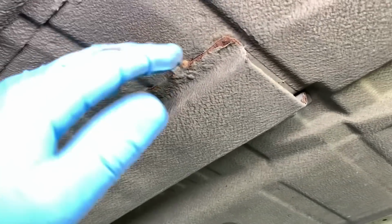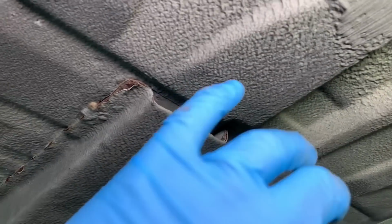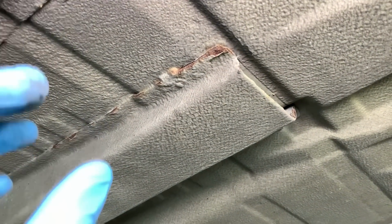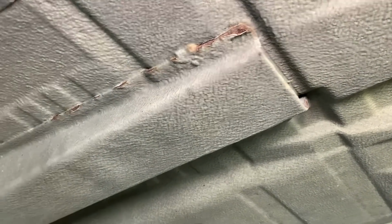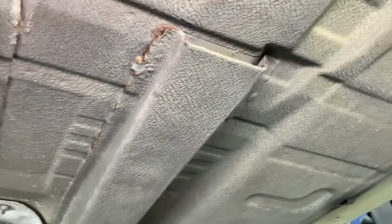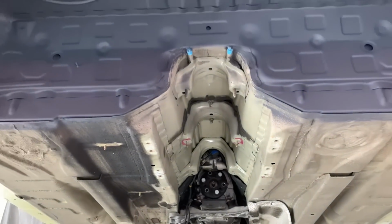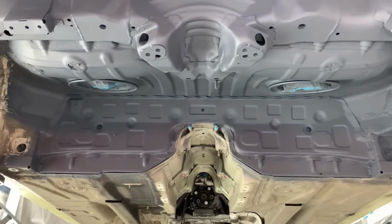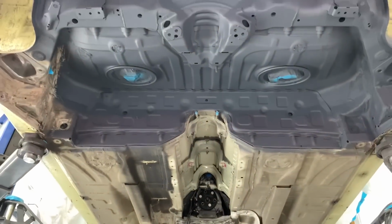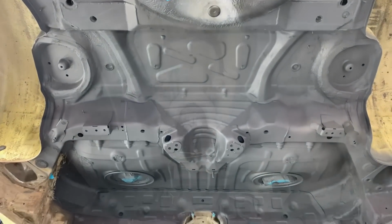So we're just working at the moment and talking with the owner, just deciding on what's going to be done, whether it's going to be a localized treatment and then flood it with cavity wax after, to try and lower that environment risk of where corrosion can regrow, or whether we're going to take the chassis leg off like we've done on some of the more complex ones and actually media blast it and take it back to bare metal, possibly even weld on a new chassis leg end. Depends if that one's manageable. So lots of work already gone on and lots of work still to come.